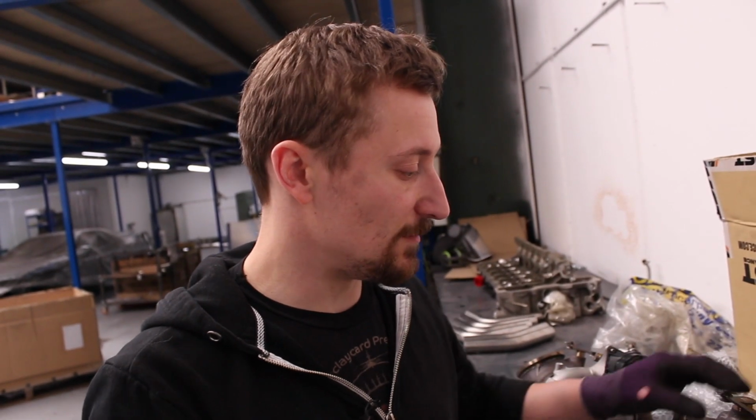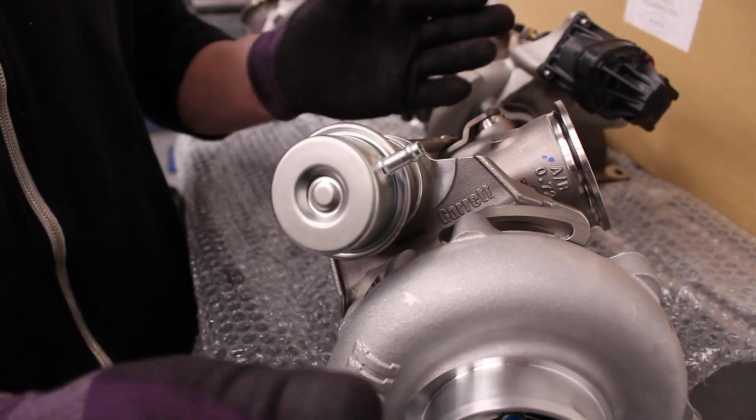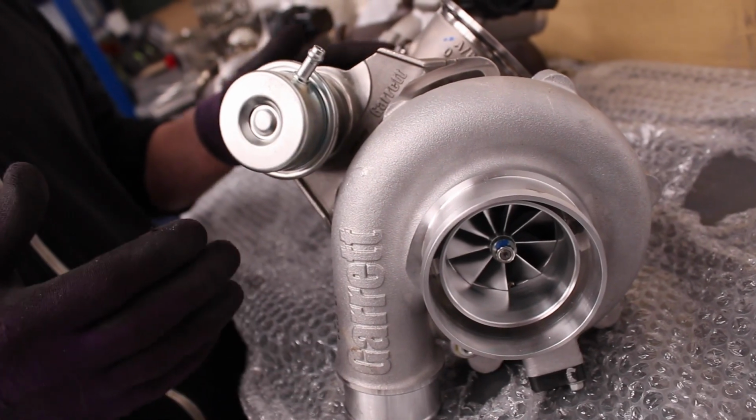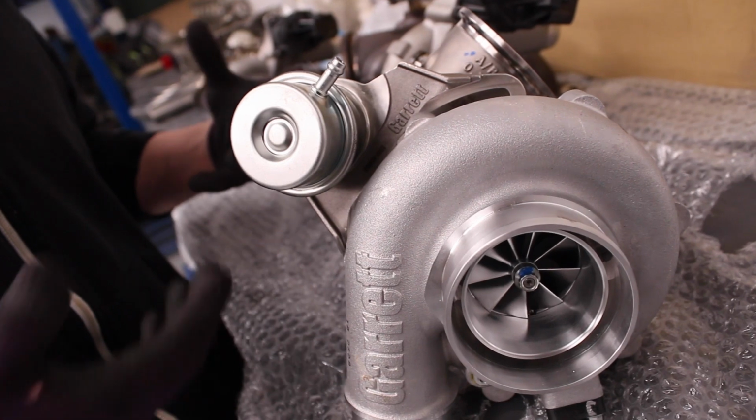Part of the challenge is going to be that, again, that actuator is so much bigger than a pneumatic actuator, and we're also fitting in two much bigger turbos. It becomes a bit of a challenge to basically cram it all in.